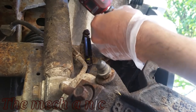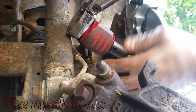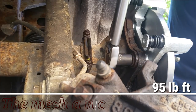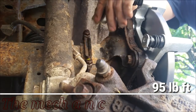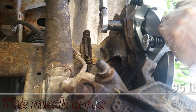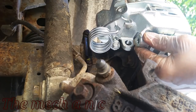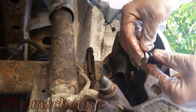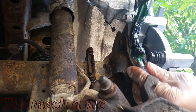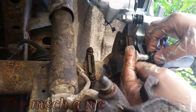The fasteners that hold down the caliper bracket to the knuckle have to be torqued down to 95 pound-feet. I don't have a torque wrench that goes up that high — my 3/8 torque wrench only has a maximum of 85 pound-feet, so after I reach that 85 I'm just going to go back at it with a regular ratchet and give it an extra turn. I also checked the slide pins and added a little extra caliper grease since there wasn't quite enough on the new unit.